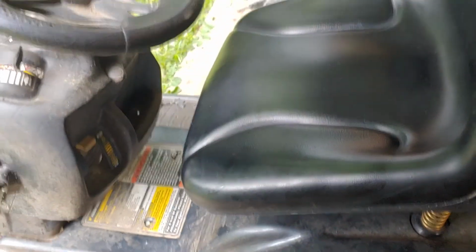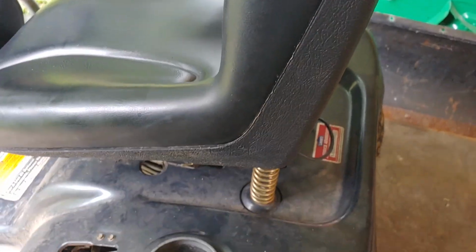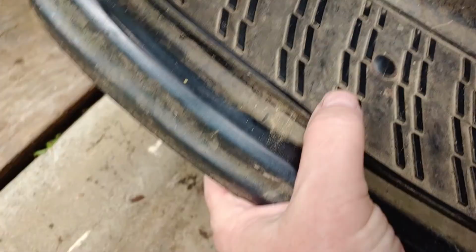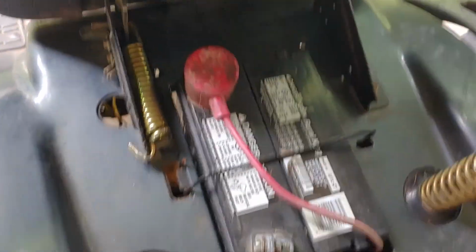Okay, putting back together stage. The fender is pretty easy to come off, really. There's 2 bolts under here. There, you can see that when I replaced it because it was about rusted out. 2 carriage bolts, the 2 hiding under the sticker, and then there's just the ones that also hold the seat on.